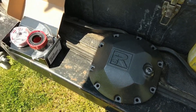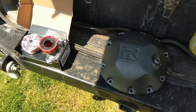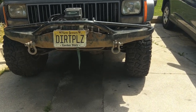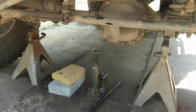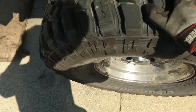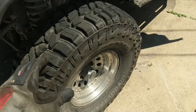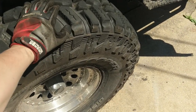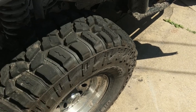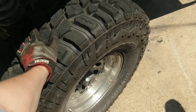I think that'll do it for the upgrades, so it's time to start tearing into the axle. Step one: jack it up and tear it down. Up on jack stands. That bearing is freaking shot. I wonder why my brake pedal kept going down, getting tight, and then going down further — it's because the wheel was crooked and then pushing on the caliper actually straightened it out again. That's a telltale sign your wheel bearing is shot. The old Jeep's loud, so I don't know if it was noisy or not.